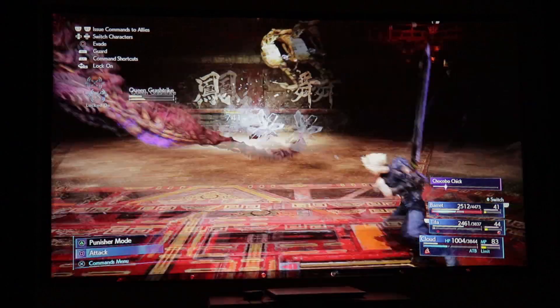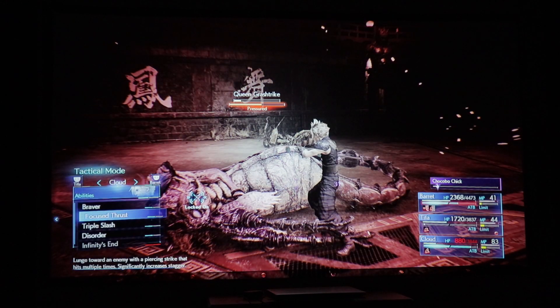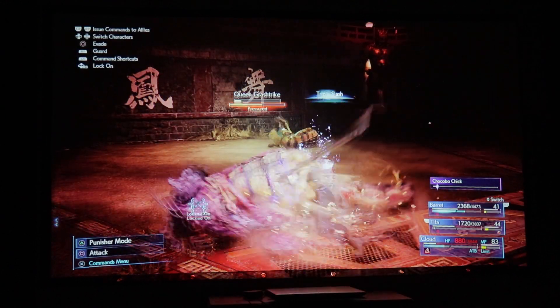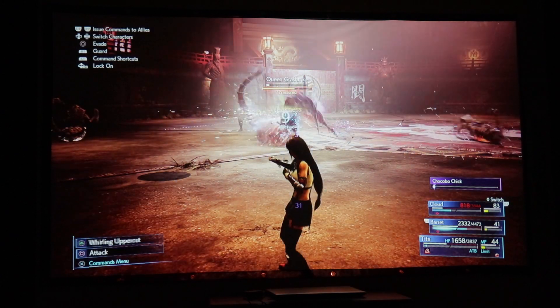Regarding quality: in the $200 and under budget range, you're going to have some blurring and maybe some artifacting around the edge of the screen when using keystone correction. Manual keystone correction in my experience isn't the best, so I always tell people if you can get by without it and set up your projector more straight and level with your picture, that's going to give you a better picture overall. When you do get into electronic keystone correction and the mid-tier projector range, you'll have much better quality — no blurring or artifacts around the edges.